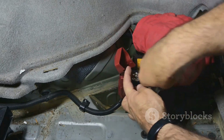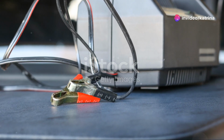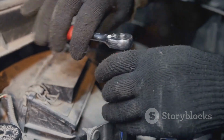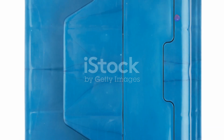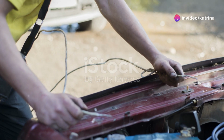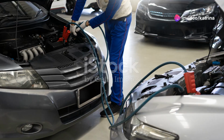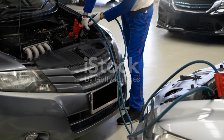and proper polarity. If the batteries are not charging, ensure your truck's alternator is functioning correctly and providing sufficient charging voltage. Examine the battery cables for damage, corrosion, or loose connections, and ensure the isolator's ground connection is secure and free of corrosion. If you're experiencing excessive voltage drop, consider using larger gauge battery cables to reduce resistance and, if possible, shorten the distance between the isolator and the batteries to minimize voltage drop.